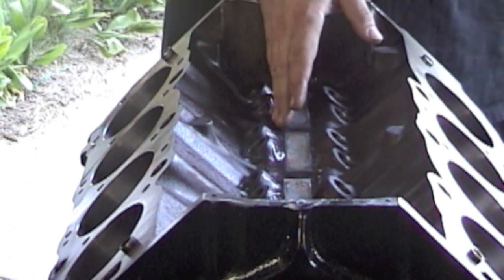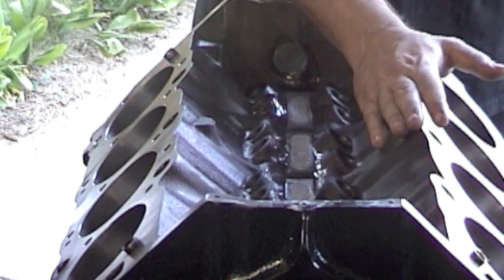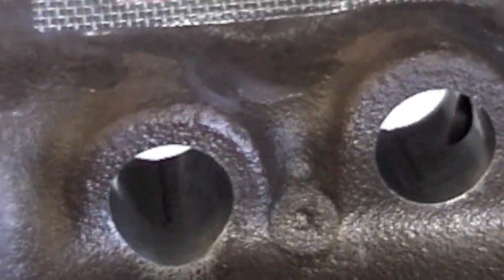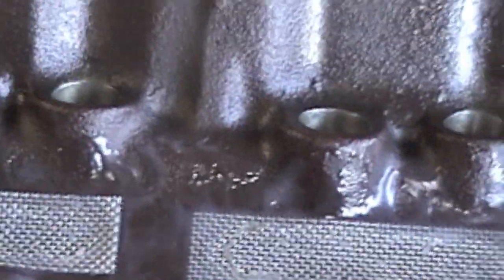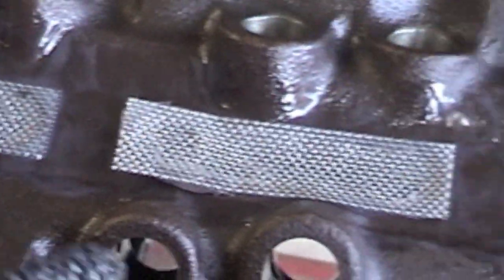Standing at the front of the motor, this is your centerline of the cam. Comp Cams says to put a groove on the outboard side of the passenger side, and then put a groove on the inboard side of the driver side. After you get done installing your grooves in the lifter bore, take a ball hone brush — size 7/8 — get some 30-weight motor oil in a plastic squirt bottle, put the ball hone in a drill motor, work it back and forth keeping oil on it, and do that for all of them. Then clean it out and take a lifter to check it's not hanging up on anything.